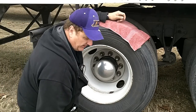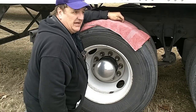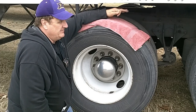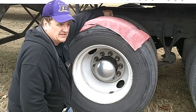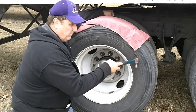So even though there is air in this tire and it will roll, it will get hot sometime during the day — even on a cool day like today. The slacker tire will get hotter than the fully, correctly inflated tire, and this tire will blow.